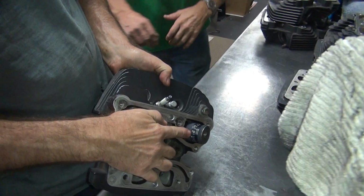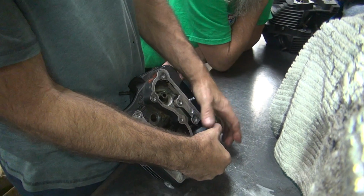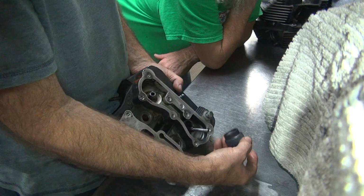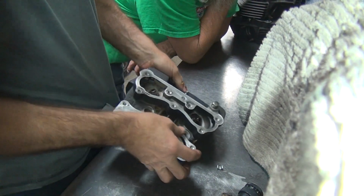Case out in 71 now. I took out a 15 thou shim. So it's a little bit safer instead of packing it all the way into the limit. Gives a little extra clearance. It is only a street bike, so no reason to push it to the absolute limit unless you're going to drive it that way.